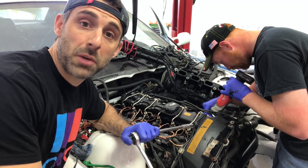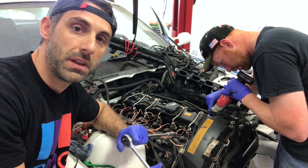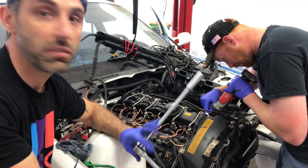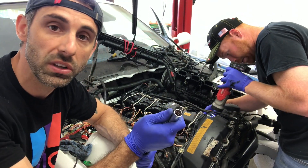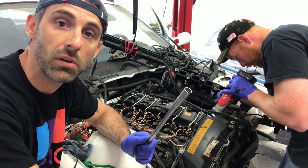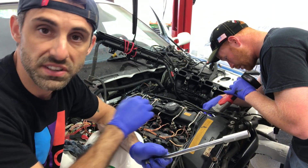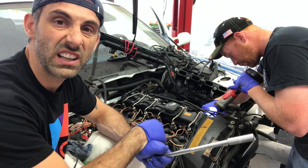We want to remove the spark plugs so that we can blow air through the spark plug holes and out, making sure we have minimal residual gunk inside the combustion chamber. We have a special 14-millimeter 12-point thin-wall socket - it's a special tool, about five bucks, and I'll put the link in the description. We want to replace the spark plugs anyway, and we're going to use compressed air to blow out everything when we dislodge it with the intake valve cleaner.